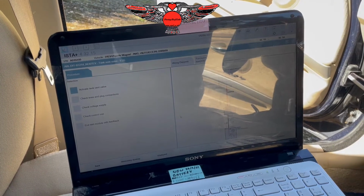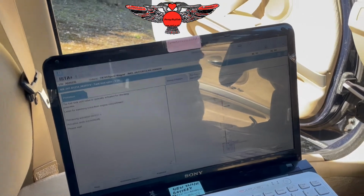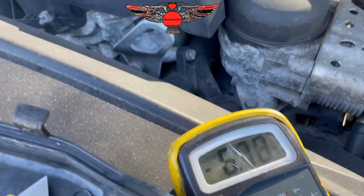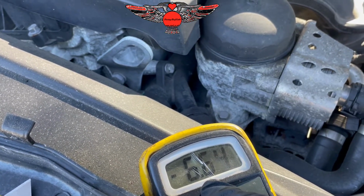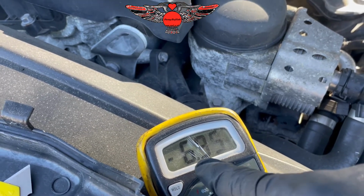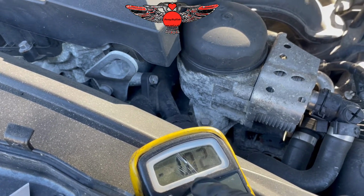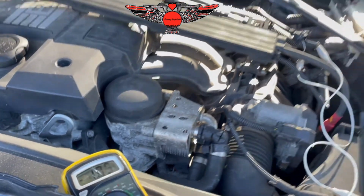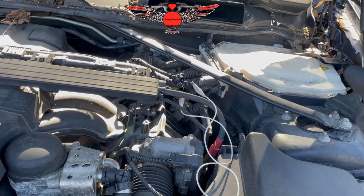So activate the valve again. 20 seconds. Okay, there we are. We have 6 volts, it's fluctuating a little bit, so we have some volts. So it's not 12 volts. I thought it might be 12. Now the activation has gone off, so it's 1 volt. So that's how you could find out if your wiring is okay or not.